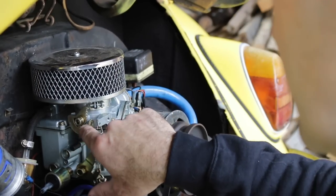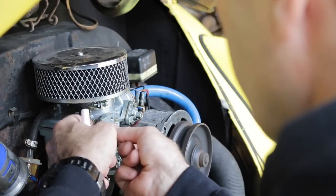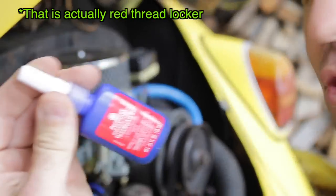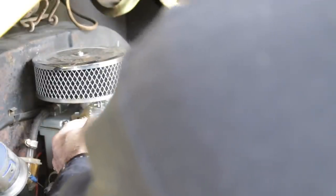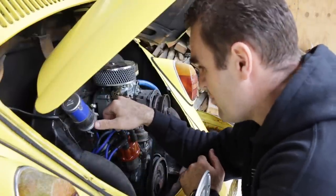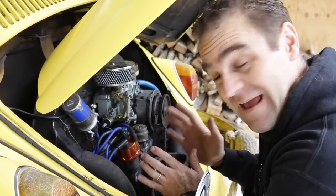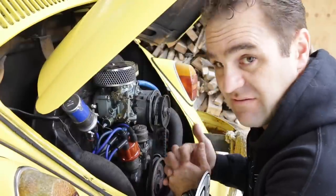Now it's nice and warm. You can actually see here that the bolt has gone again, but it does look like the warm-up cam is working properly. So I'm gonna put a new bolt on — this time I'm gonna put some blue threadlocker on it so that it doesn't come out. I put it in until it was just touching the cam and then gave it an extra quarter turn with some threadlocker, so hopefully now it will actually not fall out. We'll see.